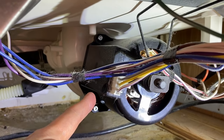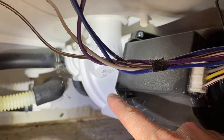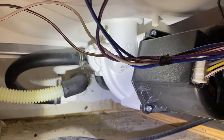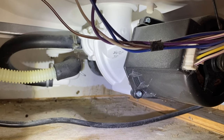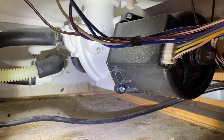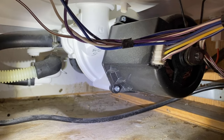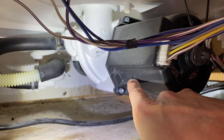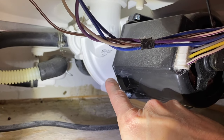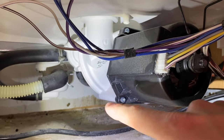An additional common cause on top of that is the internal impeller inside your actual motor housing back here. Let me move the light so you can see how the pump motor connects to the pump housing. Inside there is an impeller, and unfortunately that can fail or become loose. In the event that it becomes loose, that will make some serious grinding and buzzing noises as you are running a cycle. What a lot of people do is remove the pump motor and pump housing and inspect the internal impeller. If that looks good and it is spinning freely without making any noises or rubbing against the sidewall of the housing, they then go on to replacing the motor. However, most companies that sell the pump motor actually sell the housing connected to the pump motor that already has a brand new impeller installed inside it. So in our opinion, it's nice replacing the entire pump and housing at once — all you'll do is remove this and put the new one in.